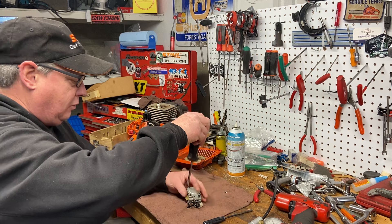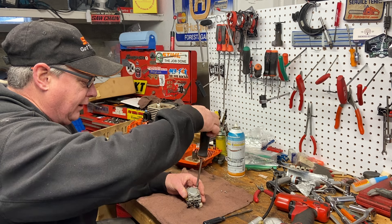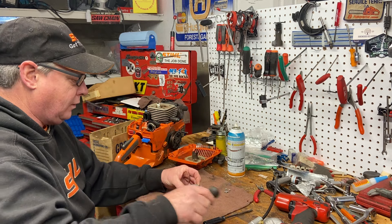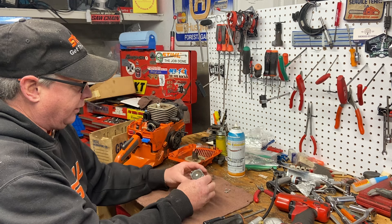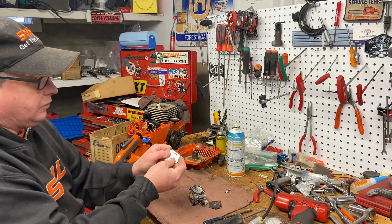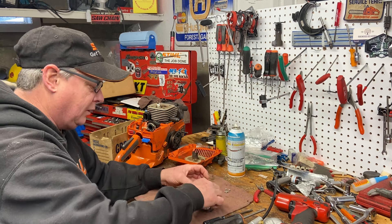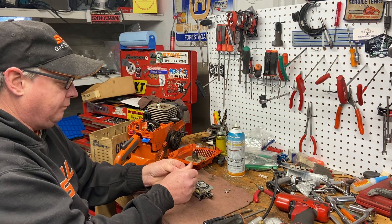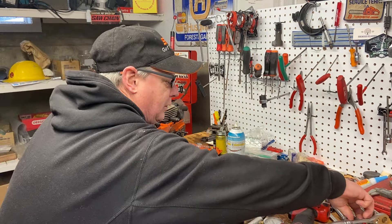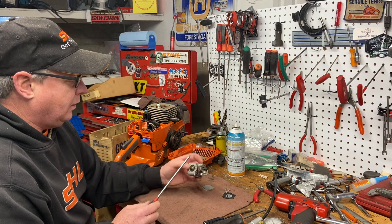Four screws. When you do a carburetor — I've done lots of videos on this — remember to lay your parts out as you take it apart so you can reassemble it properly. There's a little bit of crud on top of the metering diaphragm, but that's pretty normal. They do have a vent hole here — watch out, because sometimes these get filled up with sawdust and it'll start pushing the diaphragm down, making it flood and run weird. It looks in good shape — not hard. On the metering side, the sequence is gasket first, then the diaphragm.